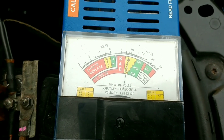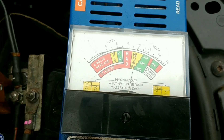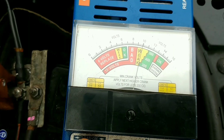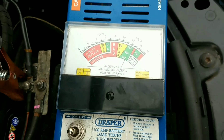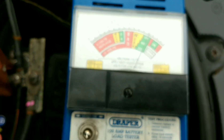I'm going to hold this for 10 seconds: 1, 2, 3, 4. See, that's in the weak range. So it's weak — the battery is weak. But it's been charged and I drive it a lot, so it's just a case of a weak battery.